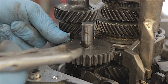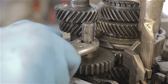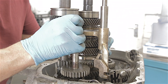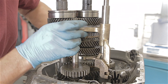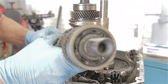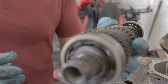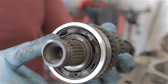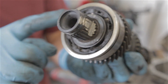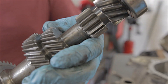I wanted to take this reverse gear off, but the shaft that the reverse gear is sitting on seems rather tight in there and does not want to move, so we'll leave that for the minute. This is the input shaft and this is what I'd call a lay shaft. That's one shaft out. This is the end of the input shaft where I had all the trouble — I had to cut the gear off. Funnily enough, looking at this shaft now, you could probably press a new gear on and you'd never know the difference. You'd have to change that bearing though, which obviously seized up solid — it only moves a tiny bit, it's seized solid. The actual gears look okay.